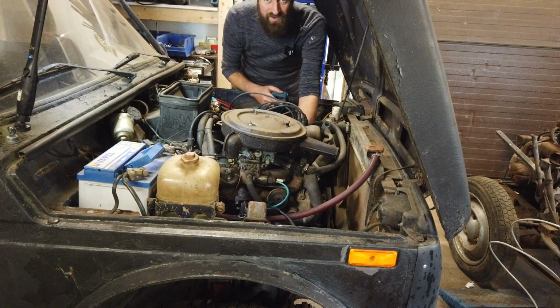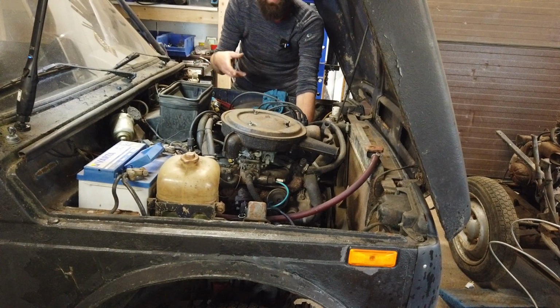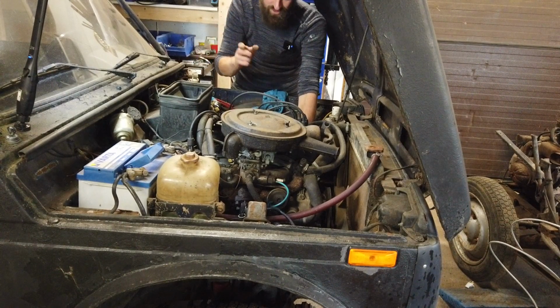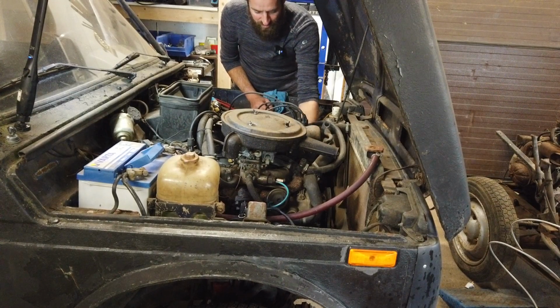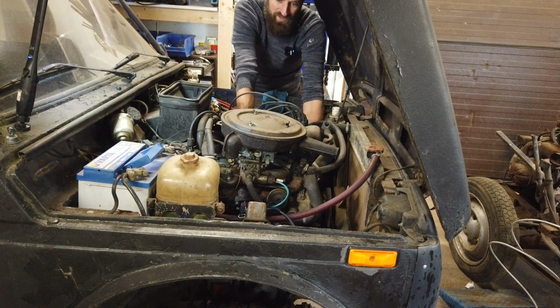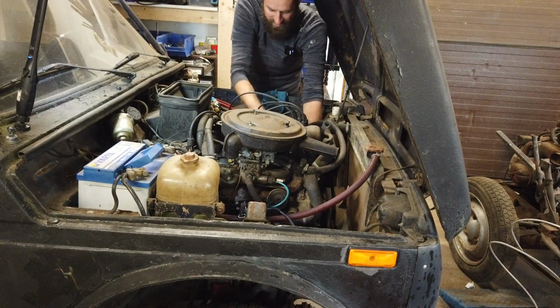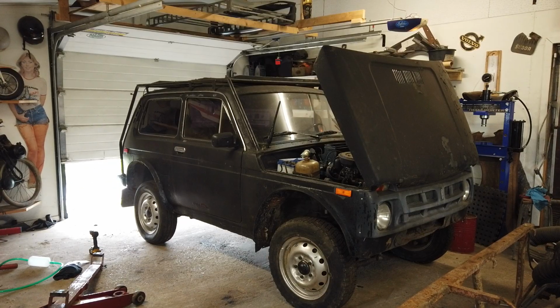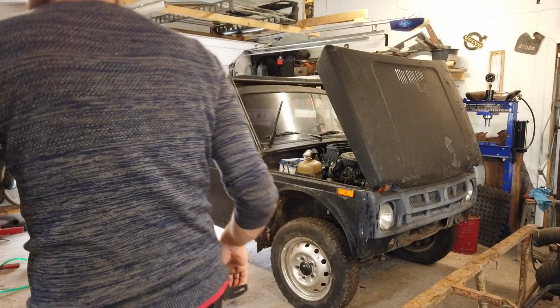And it's really satisfying to just turn a key on an old car that hasn't run for a long time and it just fires up. I'm not saying it's going to, but this will help a lot, that's for sure. I'm just going to pump it a bit more to pump fuel into the carb and fill up the chambers, hopefully. I'm just going to rig you up right here instead and open up the door so I can drive it out if it works.